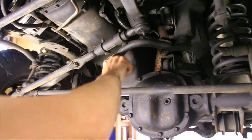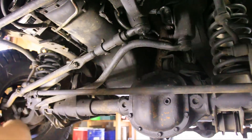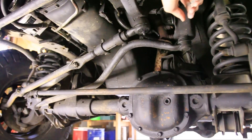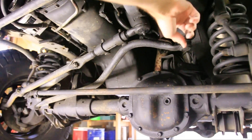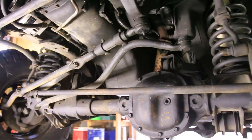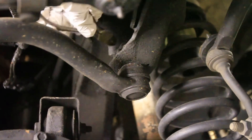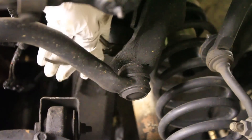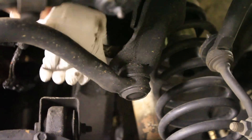This is the track bar we need to change right here. This end just has a tie rod end on it, and the other end has just a nut and a bolt. Some heavy duty track bars come with a bracket that replaces this bracket and are for heavier duty applications or longer lifts — a lot of them also have a Johnny joint on this end instead of the tie rod type end. But in this case I just have the regular one, so the first thing we'll do is take off this end. The track bar has a castle nut on top and a cotter pin — it's kind of hard to get to, but I usually use wire cutters to pull that cotter pin out.